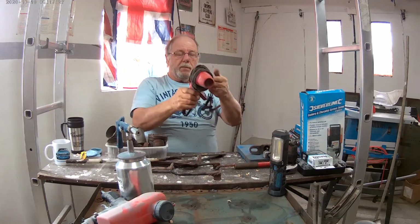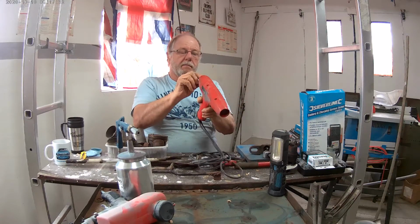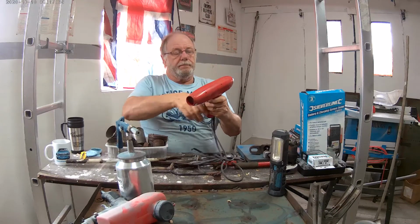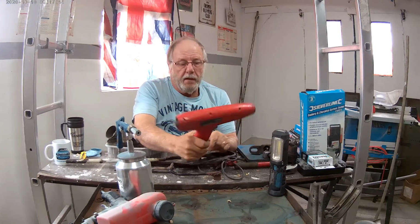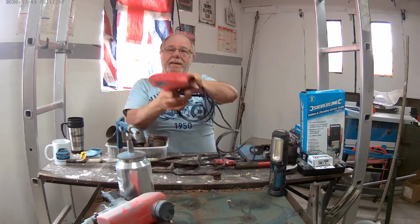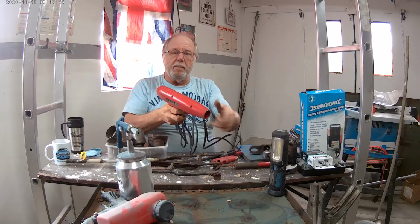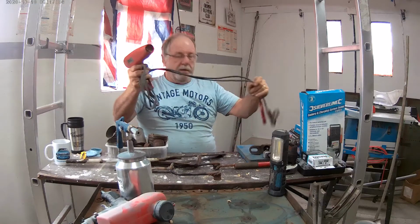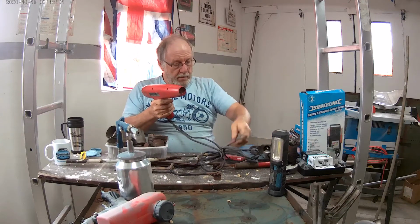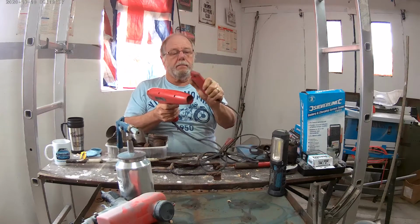Well, people wouldn't recognise this, and it's a timing light, strobe, timing advance tester. It's got the setting there, so you can set it on this. Some are just static. You put your timing mark on your pulley, put it on number 1 plug, start your engine, it's shining the light every time it fires. And you can get it to where you want it accurately with this one. Connects to the battery, connects to number 1 plug. Like that, you see. All great stuff.